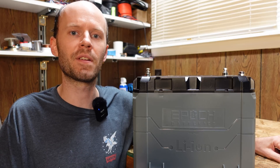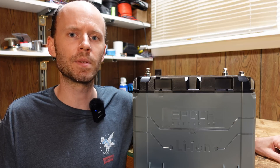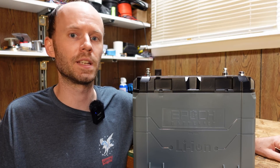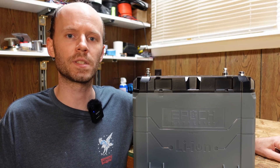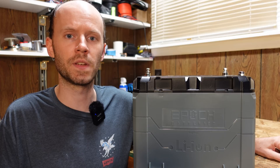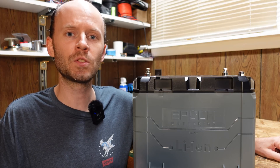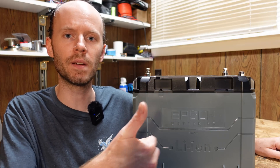This battery is very well built — a lot of thought and engineering went into pretty much every aspect of it. I especially like the temperature sensors on the positive and negative posts; if there were a loose connection outside the battery, those sensors would detect the heat and shut down the battery to prevent further damage. This battery sells for $699 with free shipping. The company also provided a discount code for 10% off, bringing the cost down to $629 — the code and purchase link are in the description. The battery is available in 12, 24, 36, and 48 volt configurations. Feel free to leave any questions or comments, hit that like button, and thanks for watching.